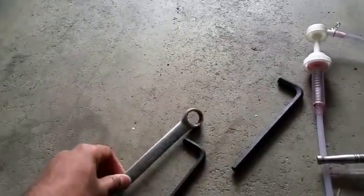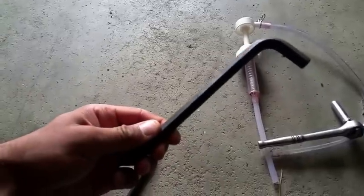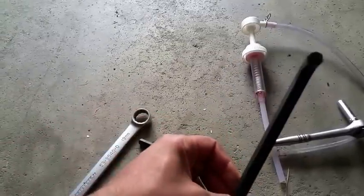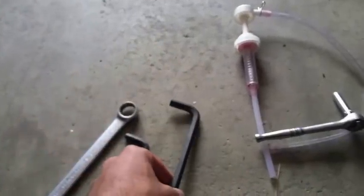You need some sort of a wrench just for leverage. And for the drain bolt you need a 10mm hexagonal socket — you could use a socket or an allen key and just get leverage with that. Also, the car needs to be perfectly level when you jack it up, because if the transmission is not leveled, the fluid is not gonna be leveled and the appropriate amount is not gonna go in.